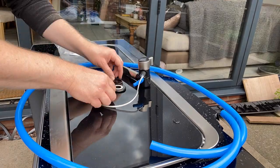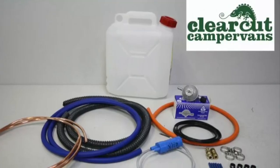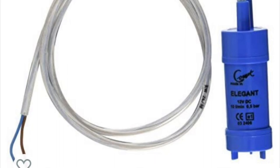Item number nine was fitting the water pump that attaches to the microswitch tap for the cold water feed, part of our Smev 9222 unit. When it arrived as a kit with the water pump and water bottles for waste and clean water supply, the water pump itself wouldn't fit through the aperture of the water bottles. The supplier acknowledged it was their error and replaced the item. Always double-check your components and check the aperture of your waste water bottles.